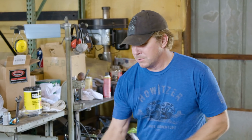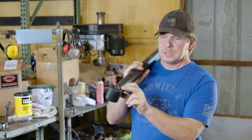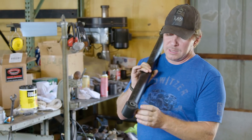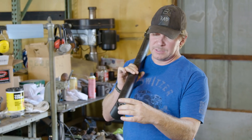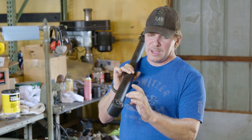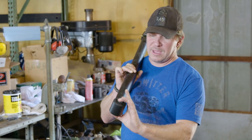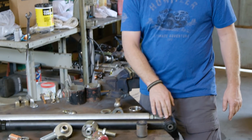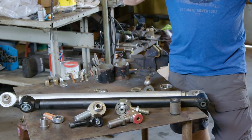Most of the OEMs will use a basic bushing. The bushing is like you have the metal link and there's a tube, and then at the end of it there's some sort of rubber or polyurethane or flexible bushing and then a metal tube in the middle of that. You run a bolt through that into a bracket and that works as your suspension joint. It moves, but it doesn't move a lot, and it doesn't transmit a whole lot of noise from the road to the vehicle, so most late model vehicles are more concerned with noise reduction than a lot of flex.